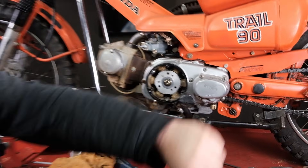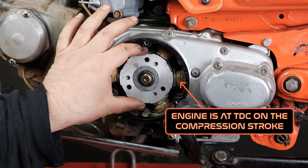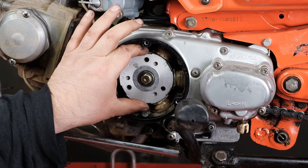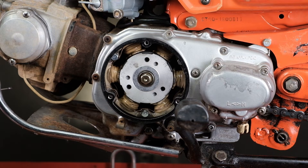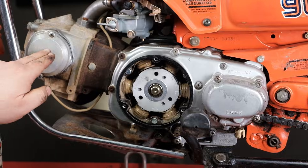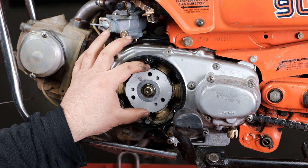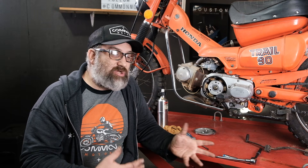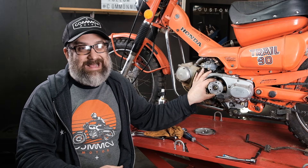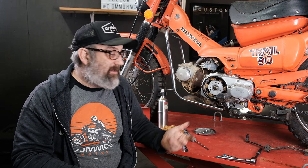How do we know we have slop in the system? Take a look at this. I have my rotor cover off here — we removed the shift lever so we can see better, but you don't have to do that for the adjustment. That is just slop in the cam chain, and it tells me that the tensioner isn't putting enough tension on the cam chain. That slop will then have an effect on the valve adjustment and cam shaft position, which has an effect on the ignition timing. If you grab the rotor and you're not feeling a lot of slop like this, you're fine to move forward to doing the valve adjustment. But in our case, this is really sloppy, so we'll try to remove some of that slop right now.